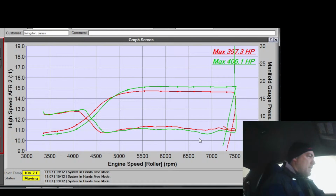I like the idle recovery on that. Still pulled timing as I started the loading process. It didn't actually pull timing during the pull. It was right as I initiated the load, which could be just some closed loop map stuff, because it's running a 13.0 right there at a couple psi. What's it at? Yeah, I got to 3-4 psi pretty quick.